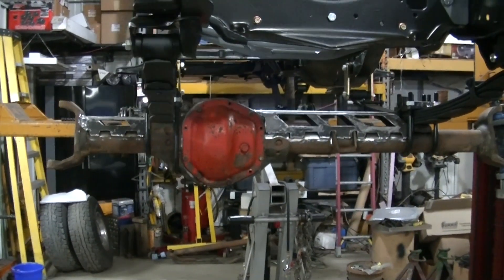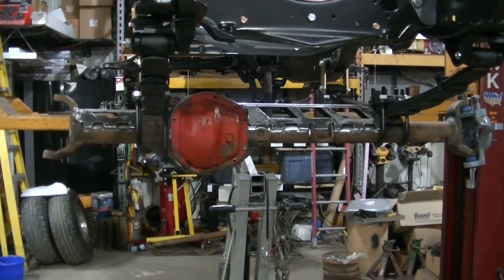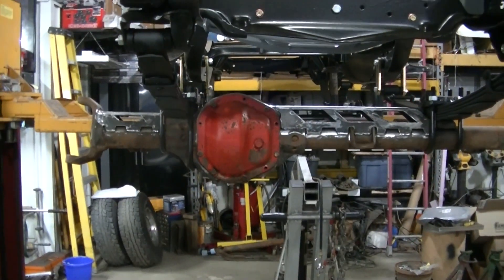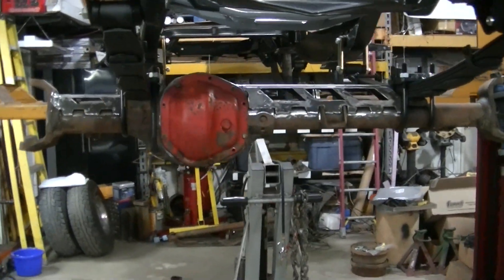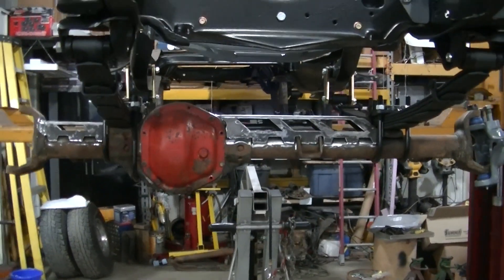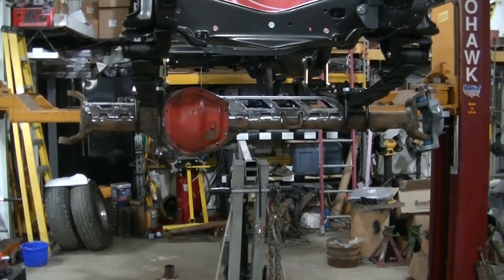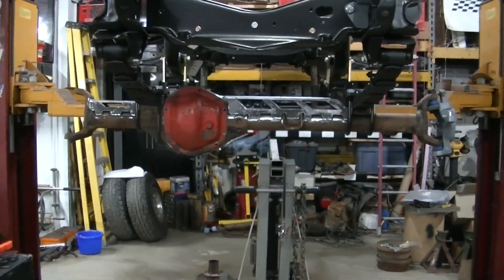I did think about going with 35s on the two-and-a-half-inch lift — big tires on a small lift is a neat look — but I only got 3.08 gears in it, so the bigger the tires the worse that's going to be. We'll see. I like it — I think it turned out awesome and it's going to look really good under there. Now that this is all welded up, I can take it off the frame, clean it up, and paint it just like I did the rear axle, so I can start assembling. I think I've got most of the pieces ready to go, so that will be the next video. That's going to do it for this one — I'll see you next time.